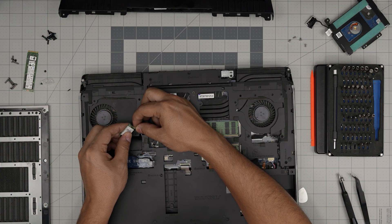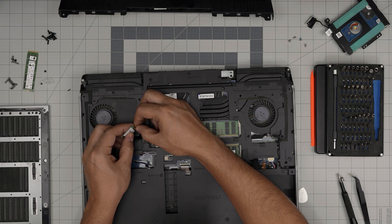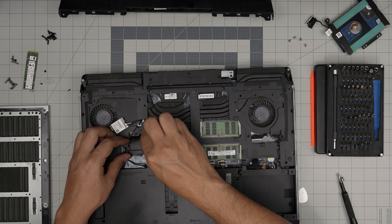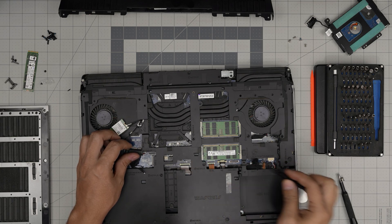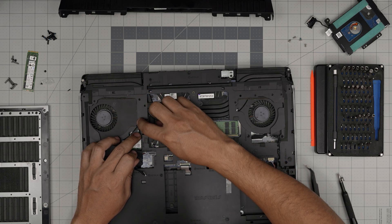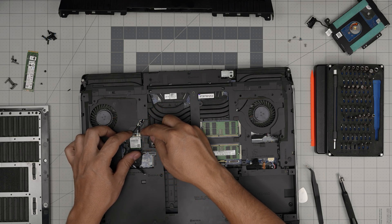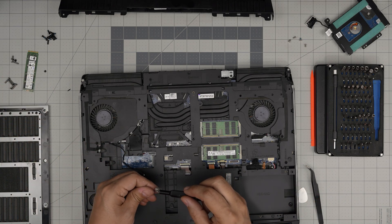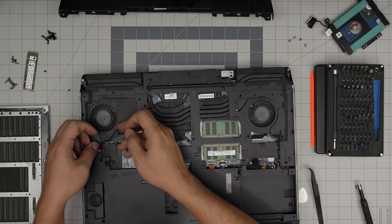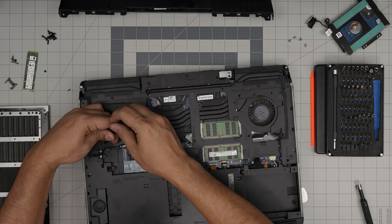Go straight for the Wi-Fi — grab the connectors, align them straight over, and pinch them together. You should hear a tiny click sound for each one. Once that's done, this paper bracket goes right underneath. Slide the Wi-Fi board inside the connector jack, and before pushing it all the way down, grab the bracket to prevent the cables from coming loose, slide it over, push it down, and put the tiny screw back.